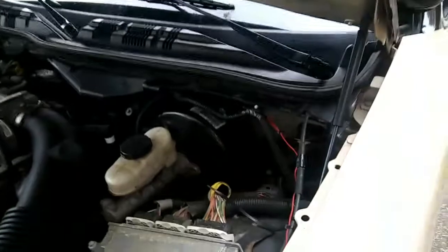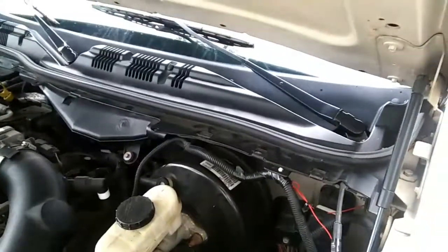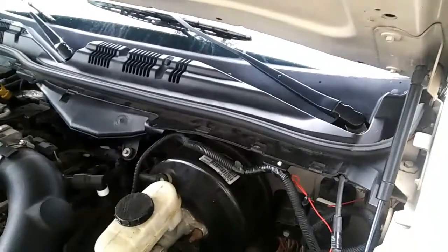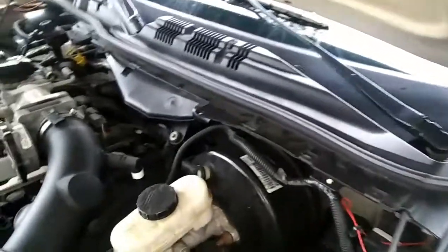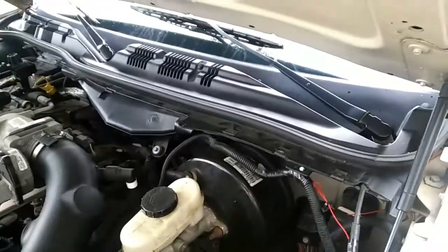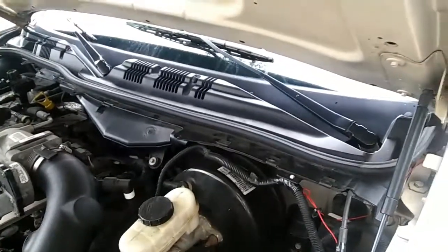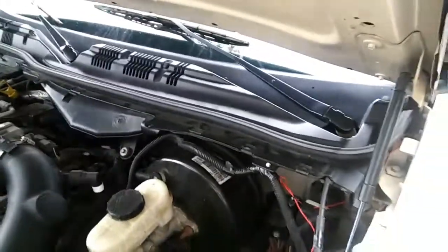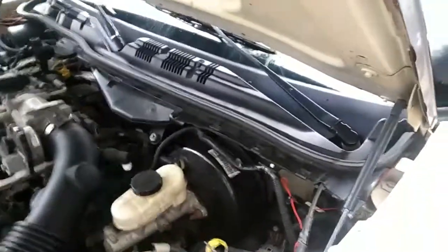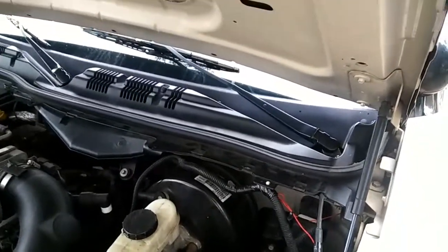I spent $85 to have the switch put in. He power probed the wiper motor connections, and he missed one thing, the control circuit power. By missing the control circuit power, he caused me a serious headache. So, it's not hard to ask your technician, if he's already got your car torn apart, to check that control circuit. Everything else was getting to the unit itself, except for the power for the unit itself. That's why the message wasn't being received.